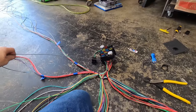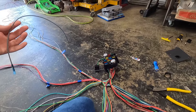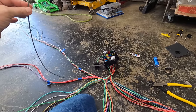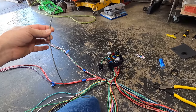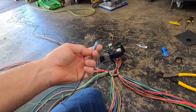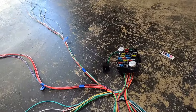Now, electric fan — that is something that if we put AC on the car, we're definitely going to put an electric fan on there to help with cooling, especially when the compressor is running and it's 100-degree temps outside. So this is the power wire for the fan and it is connected to the fuse box. I'm going to tie it up and put it behind the kick panel or something. I put a barrel connector on the end of it and heat shrunk it in — one of the shrinkable ones — so that it doesn't get into anything and short across anything.